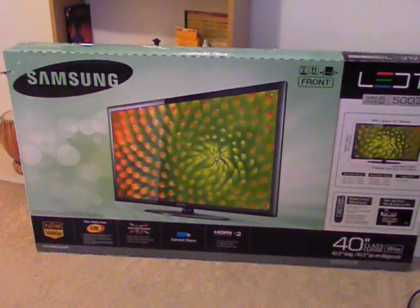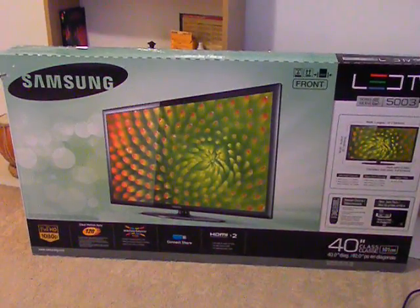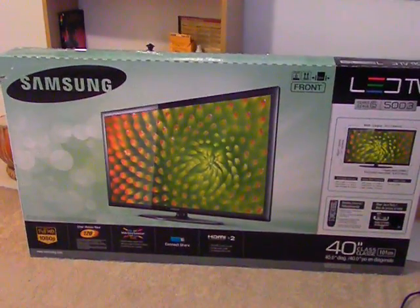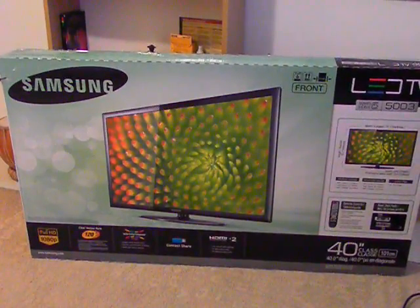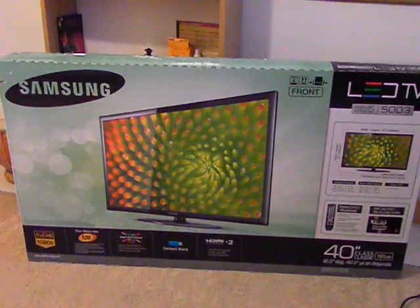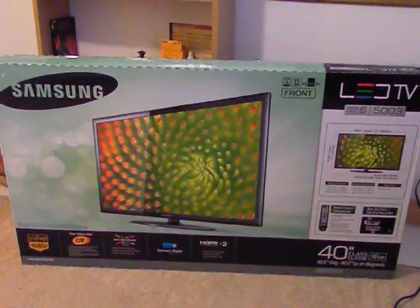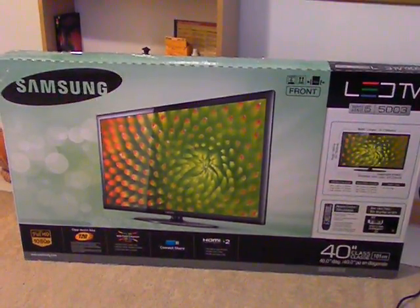This is a full HD 1080p TV with 120 Clear Motion Rate technology, and that doesn't mean 120 hertz. It's a 60 hertz TV, but it has a 120 mathematical motion rate algorithm, really to allow movies which are shot at 24 frames per second to divide nicely into 120 times. So I suspect Samsung is using a 5:5 pull down for this TV, although I'm not actually sure. They don't state it anywhere.